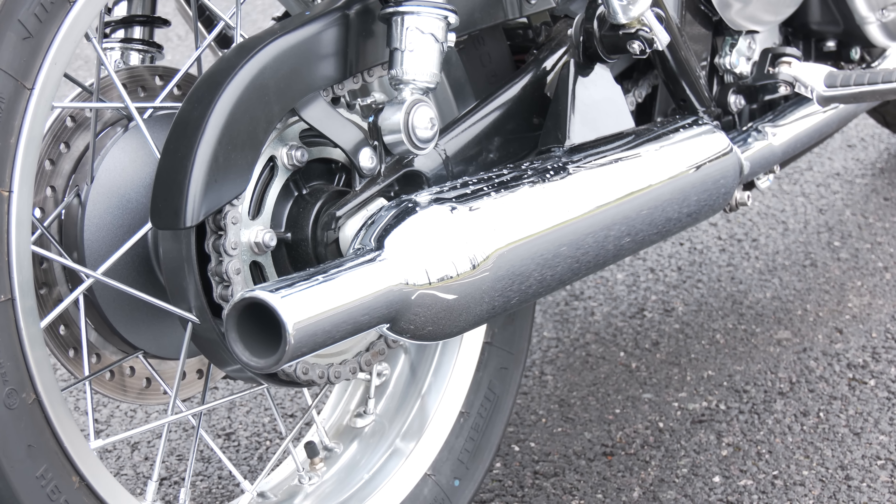The bike hasn't been cleaned on purpose — I wanted to show you what you'll be up against at this time of year. The mudguards could really do with a hugger extension. Look at the radiator: anything on the road — leaves, mud washed out from banks, tractors — gets thrown up at the radiator. There isn't any protection for the matrix. We could almost do with a grill cover here, and an extension on the mudguard. You can see the amount of debris that's been thrown up at the collector box for the cat.